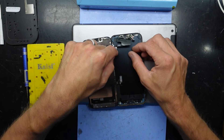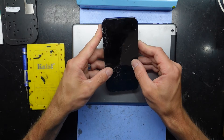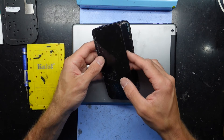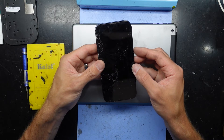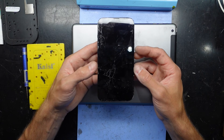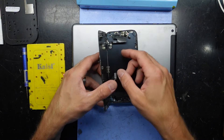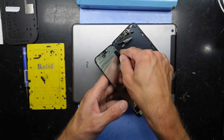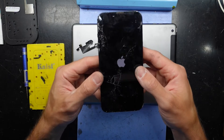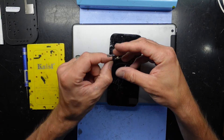I'm hoping that I can just get a replacement one and away we go, but I'm not completely convinced that will sort it out. As we can see, we've got heavy crush damage and signs of liquid damage. We've already restarted — the Apple logo should come back up and then it'll loop from there. If I disconnect the front sensor flex once more — now disconnected — it will happily stay on the Apple logo. So I'm not sure how this particular sensor is causing it to reboot, but as you can see it's just started up just fine.